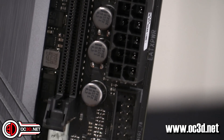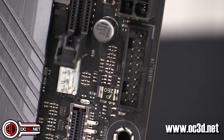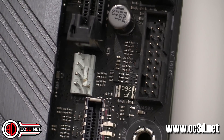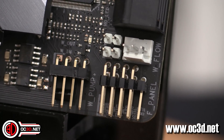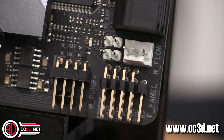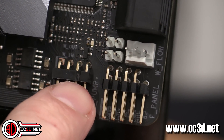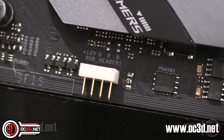Then the 24-pin connector, and skimming past that you get your external USB 3. There's another full-speed fan header there — it is a four-pin, even though it looks like a three-pin from a different angle. Going further down, external USB 3.1 and four SATA ports. Down in the bottom corner you have the water flow sensor and two thermal sensor headers for your water cooling — one for inlet and one for outlet, or in separate positions if you prefer. The bottom of the board has all the front panel header pins, USB headers, and there's a fan header pointing downwards, which is cool, along with an RGB header also pointing down.